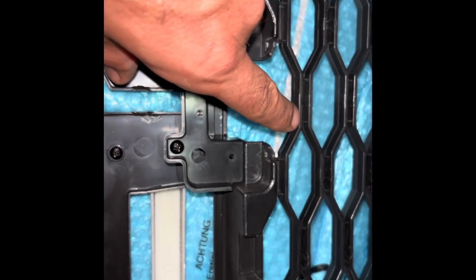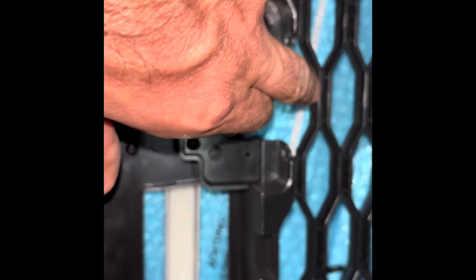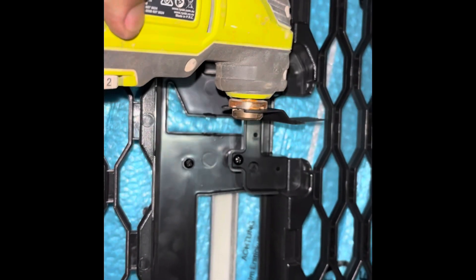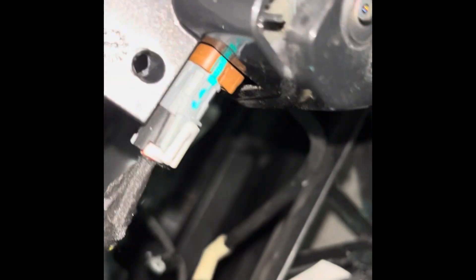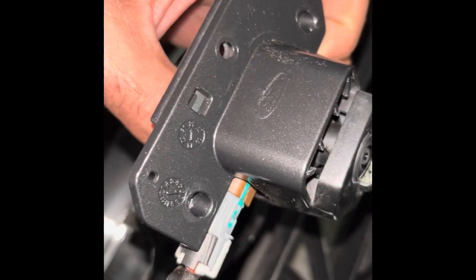This piece is just a little bit too long for the camera piece that slots in - a little bit too long to fit here. So we do have to cut a little piece out to make sure it lines up with the holes and we get the OEM fit. I'm using a multi-tool and going to cut this little piece here - start with small pieces, trim it until I get it right, because I don't want it to look butchered. The camera mount will fill the hole and it'll look like it's meant to be there, but we want it nice and snug without loose holes and flipping pieces of plastic around it.